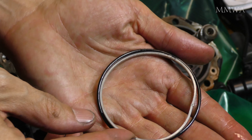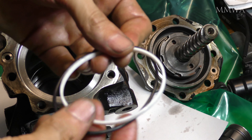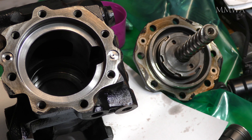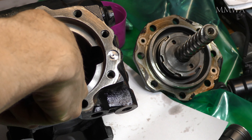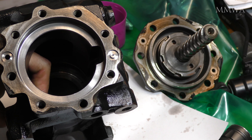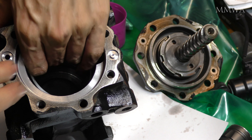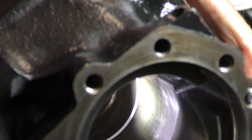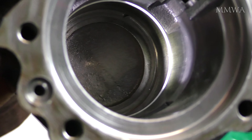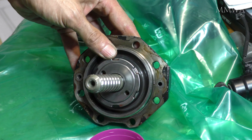And this was my special tool that came in very handy. It was able to slip underneath the O-ring and pull it out. I just used a very small screwdriver to stab into that old Teflon seal and pull it out. And it's just a case of dropping in the new ones now. If you have freakishly long fingers like me this is pretty easy, but if you have short hands you may need a child to assist you - there's not a lot of room to work. And that's the final result: the O-ring underneath and the Teflon seal installed. That housing is basically ready to go.